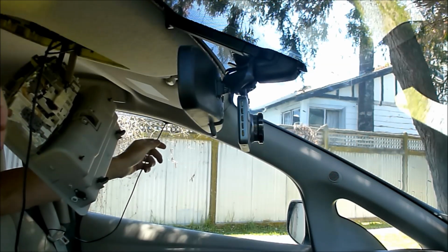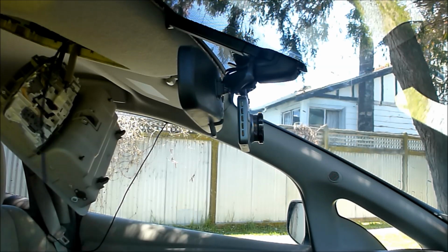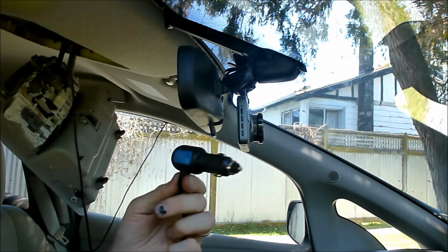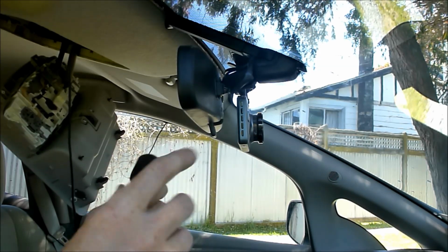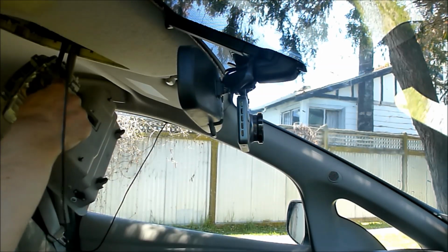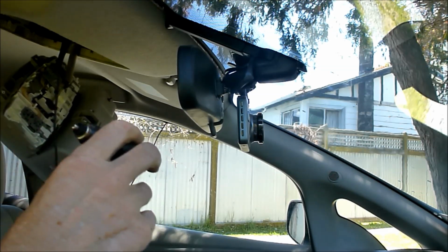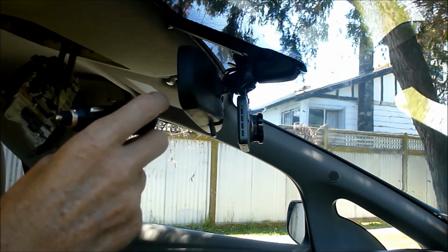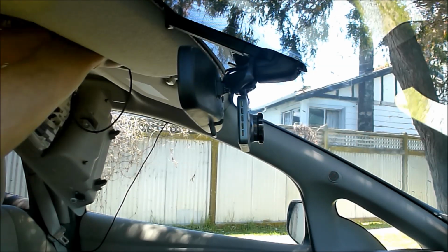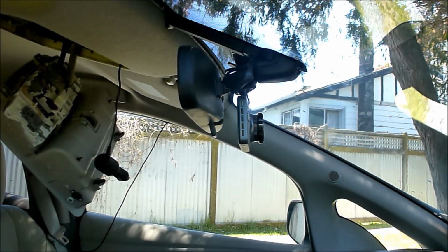All right, so the cable for the rear camera, I'm going to pull there. Now, the way this is powered is there's a car socket to 5 volts, 1 amp USB basically, converter. What I might do is just get a socket wired up to there and then put all of this cable up in the ceiling. Either that or I cut the cable and rejoin it. And that's possibly more trouble than it's worth, because there's a huge amount of space in here. So I don't really need to.